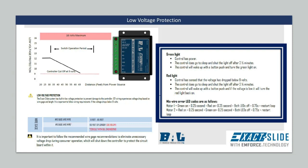Resistance between the opening in the main wall and the room can trick the controller into thinking one side is sealed, which will redirect power away from that side. After confirming the cables are tensioned properly and verifying that the voltage is 10 volts or higher at each motor, check for obstructions and resistance.